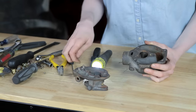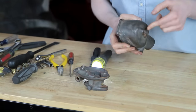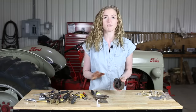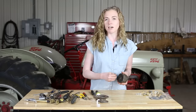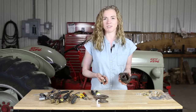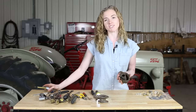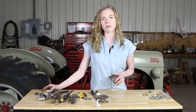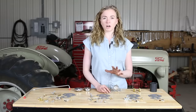You'll want to get both of those jets out because you get new ones in your kit to replace them with. Next I'm going to take this plug out the bottom for the drain, and then I'm going to thoroughly clean my carburetor. I'm going to use a can of carb cleaner with the long nozzle so I can get through all the passageways — I'll wear gloves and safety glasses, spray it down, follow with a blow-off nozzle on my air compressor, and repeat. If you want to sandblast you can, but do whatever you need to do to get your carburetor thoroughly clean before you start putting new parts in.